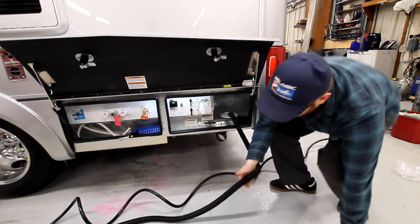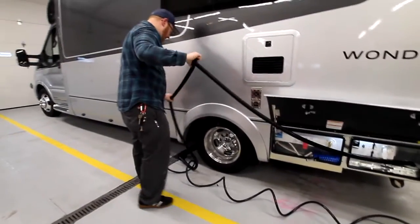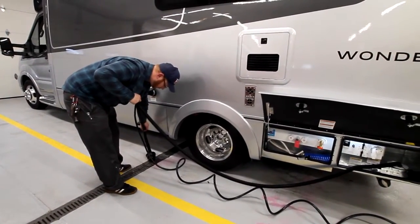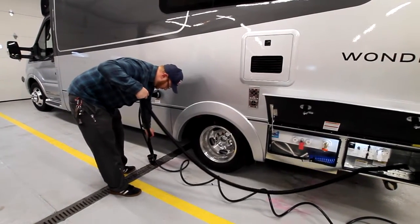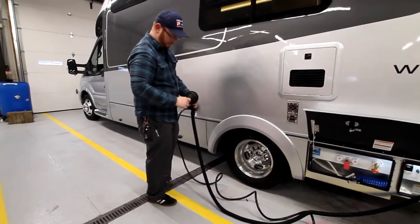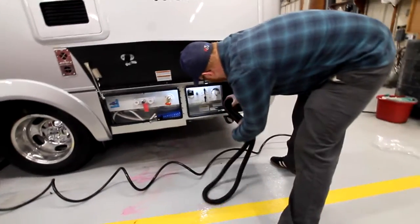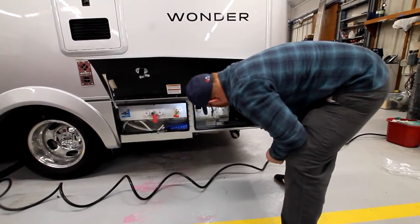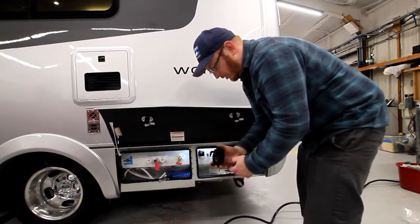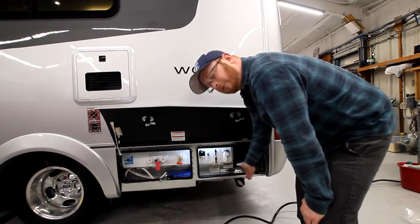Now take the cap and lift up on the hose, allowing any excess in the hose to come out the end. Once all of it is out, go ahead and put the cap back on. Take this head and put it all the way in first, then follow it with the rest of the hose. Inside here there is a cap — if you have to take off the macerator after gravity dumping, you can put this on and it stops any leakage coming through past the black or gray valve, preventing it from falling on the ground.